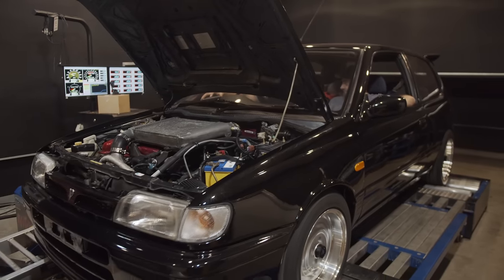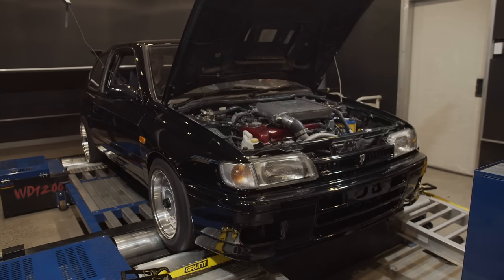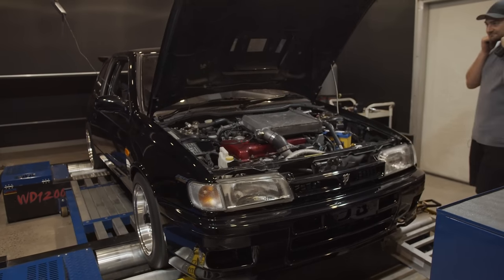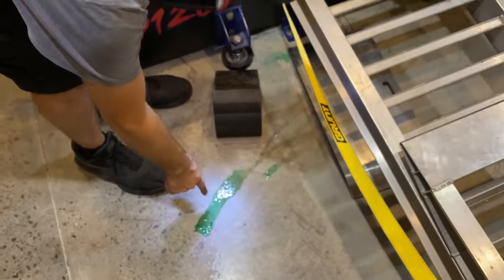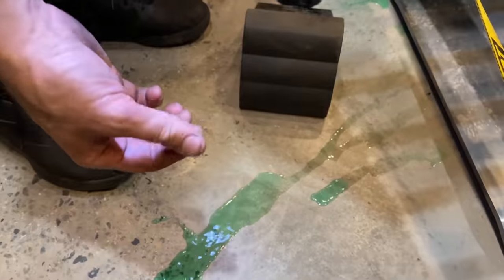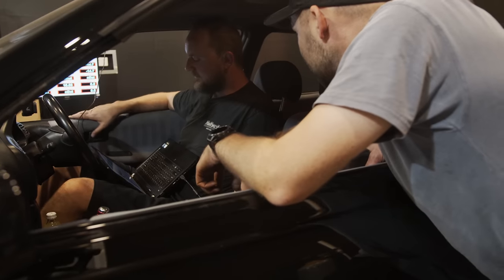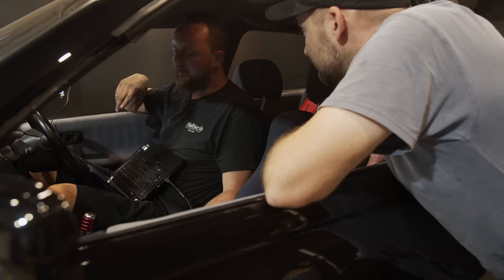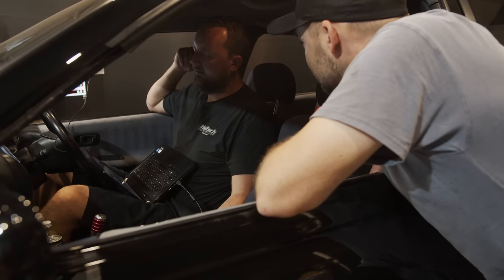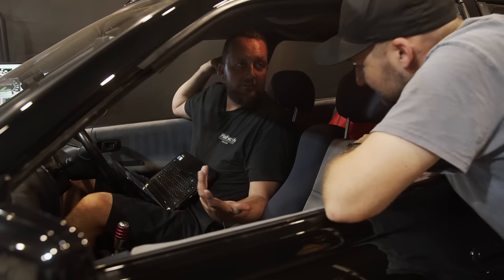While getting the car warmed up and doing some low-load tuning, we noticed some weird smells and weird liquids coming out of the old Nissan. We've got coolant bubbling over, but that may have just been a burp because this car's been sitting for so long — we may not have given it a hard enough time on the base map to burp the cooling system. It did get hot and went into engine protection, but now we can't get it to happen again. It seems to be sitting on the thermostat — possibly a stuck thermostat or a massive air pocket that needs bleeding through.